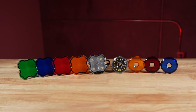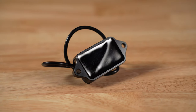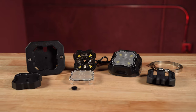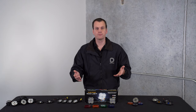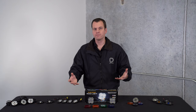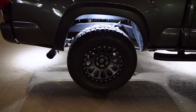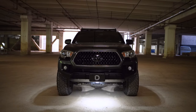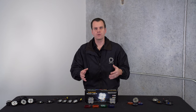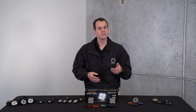We're going to look at the colors these come in, whether you can change out the lenses, and the white color temperature to see how that stacks up. We'll also look at the seal method, which is different across these models, the wiring and connector type, and mounting accessories provided — that's really important because rock lights can be a chore to install. For output we're looking at total lumen output, since lumens refers to light shining in every direction, which makes sense for rock lights illuminating small areas. Finally we'll look at the actual beam pattern and coverage, because we want to spread light out well whether that's in a wheel well or directly under the vehicle.